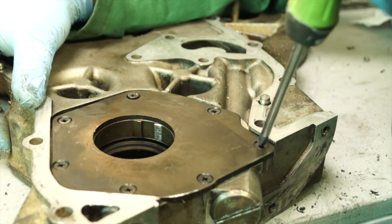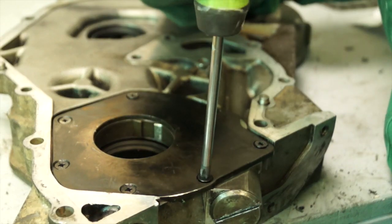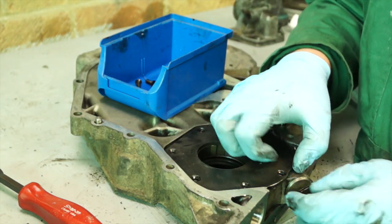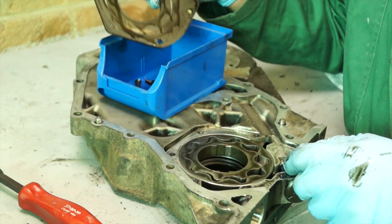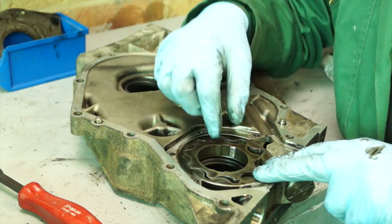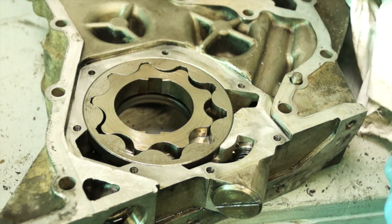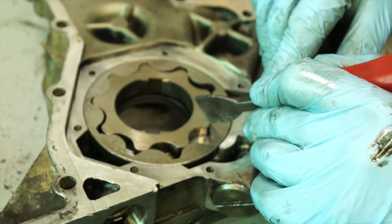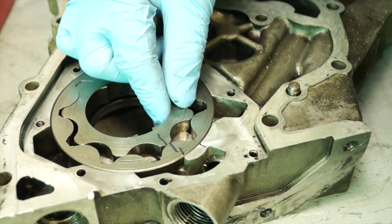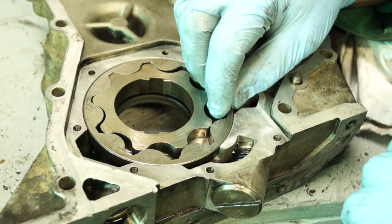For the oil pump casing, we're going to take the back plate off. Use a very good fitting screwdriver — release each screw first then unscrew them, making sure you don't lose them. This one has no silicone on this side. You can see the scoring on here — that would have been the thrust on the oil pump against the plate; we'll check that later. You have your oil pump here — this is different to the 200 TDI and earlier ones. Mark the relationship between the casing and the outer rotor, and the inner rotor to the outer rotor. I've given them a scratch but you could use a pen.